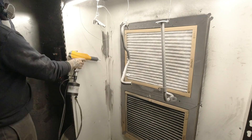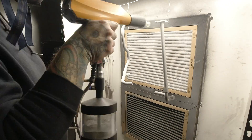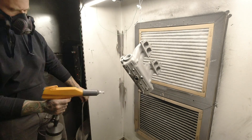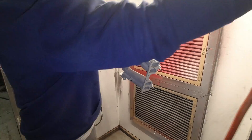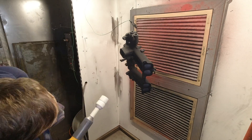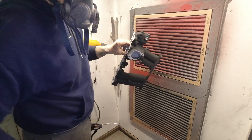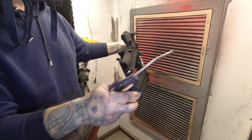If you're new to the channel, you won't know that I do powder coating. If you're a repeat offender, you'll know that I powder coat damn near everything, and I also have a playlist that teaches powder coating — feel free to check it out, link's in the top right corner. I sprayed some silver powder on everything and then went back with a wrinkle black. I rarely use masking tape or plugs on parts like this because it takes so much time, but removing powder with just a finger, a towel, and compressed air works every bit as good if you're patient with it — and it uses less consumables.